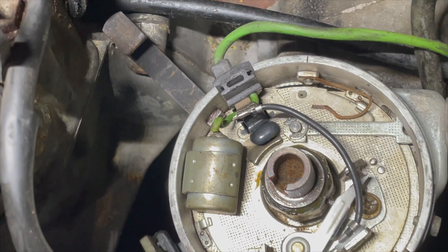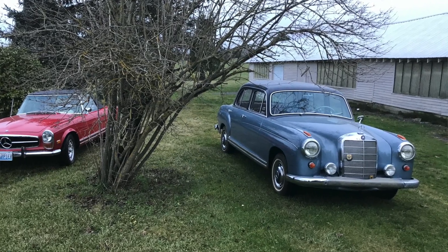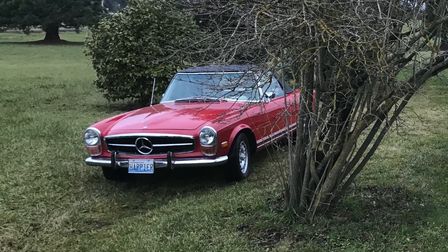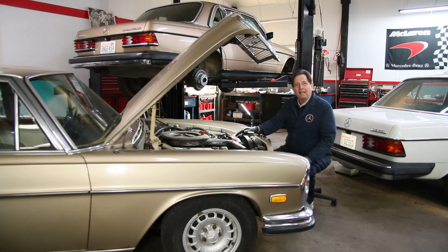I've done that on my four and six cylinder cars. My 1959 220 SE has electronic ignition. My 1970 280 SL has electronic ignition, but it's not so easy with these V8s. This is a 1972 model — it's kind of the end of the era for points condenser ignition for Mercedes-Benz. Just the other day I received an email from an enthusiast collector in Australia asking if my electronic ignition works for a 3.5 coupe, and he sent me beautiful pictures of his 3.5. That kind of motivated me to get back on this job. I know it'll work, but the problem is getting the parts that come with this unit to fit in a V8 distributor.